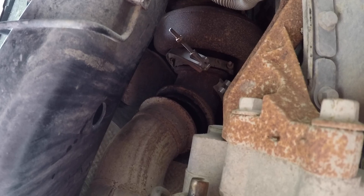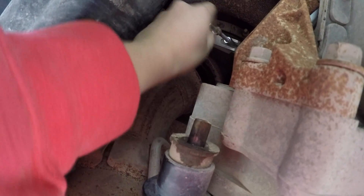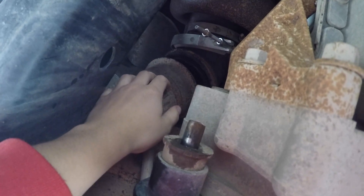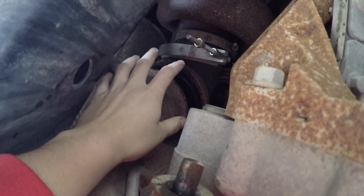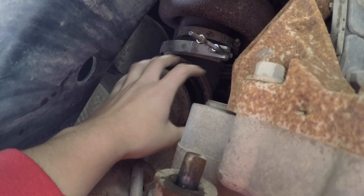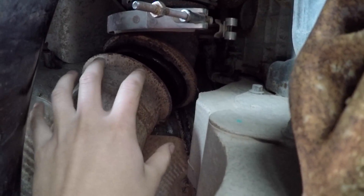What you're seeing here is the down portion from the turbo — the exhaust. You want an 11mm socket to loosen this clamp. You're going to keep this clamp for the reinstallation of the new exhaust, so don't throw that out. You're going to loosen this off — it's going to be really rusty and gross — so you'll need a flathead screwdriver to wiggle that clamp loose and shimmy it down off of the exhaust. This is what it should look like now that the clamp is off and it has disconnected.